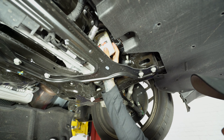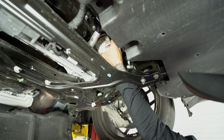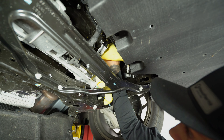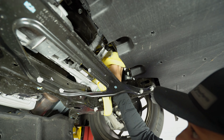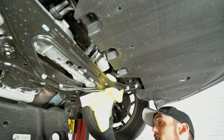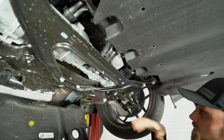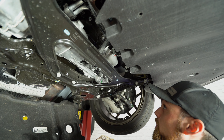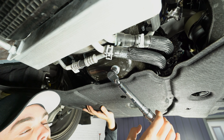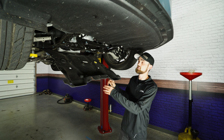When putting the filter on, it just needs to be hand tight. Grab a rag to grip it since it's a little oily. Make sure you're cleaning everything up when you're done. I like to use a microfiber because it actually cleans it. Grab some brake cleaner and spray this area off to make sure there's no oil residue anywhere. Then we will torque our drain plug — factory recommends 15 to 20 foot-pounds. After you tighten your oil filter and your drain plug, you can go ahead and put everything back together on the underside.